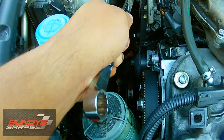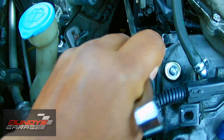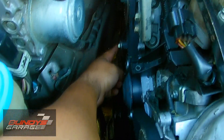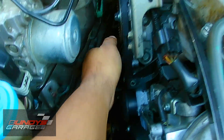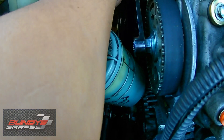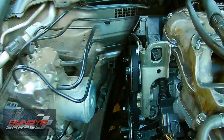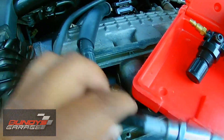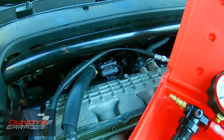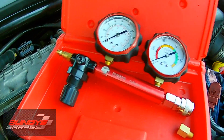So let me show you that. Make sure you're on the correct cylinder, then lock it into place with the flat part of the wrench. You can see this wrench comes out a little bit and allows you to get down in there — that's why they call it a zero offset wrench. I'll put a link in the description below where you guys can pick one up on Amazon. I'll now screw the hose down to cylinder number two, get my air compressor up to about 100–110 PSI, and show you how you connect the gauge and dial it in.